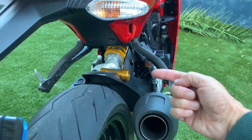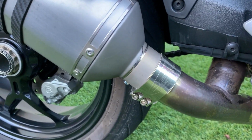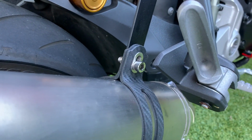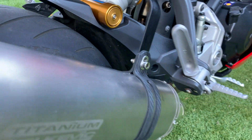So it was obviously either set up with stress from the outset, or the silencer might have come in contact with something, been temporarily bent in, and then it's created stress from then on. But the important lesson is, if you're going to install a system, set it up with as little stress as possible, and preferably none.